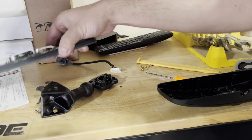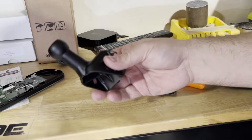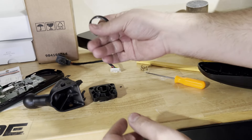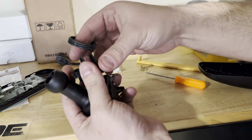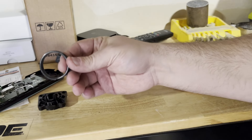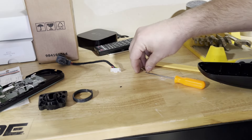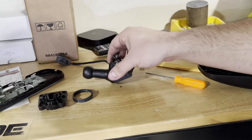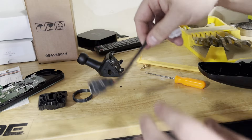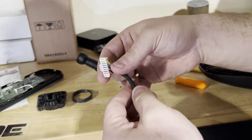When you do this, you're going to use the front mirror and back clamshell from the Accord, the stem from the Integra (which is currently still in the car), the spring from the Integra, and the harness from the Integra. The important thing is the stem must be the Integra piece because it's not going to clip up to the windshield otherwise. The small Torx screws are the same between both mirrors, so don't worry about getting those confused. When handling the harness, you're going to want to cut the felt tape insulation back — be careful not to cut any wires; use a razor pen knife.